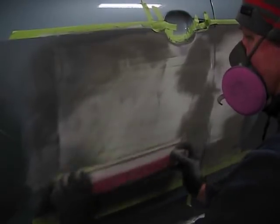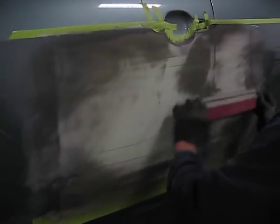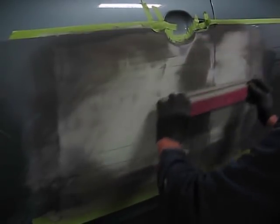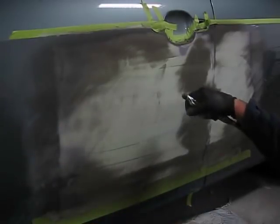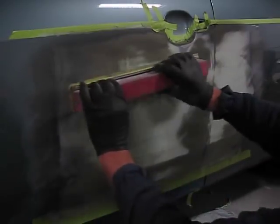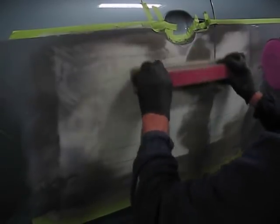We can see two areas right in the middle close to the door jamb, which I expected. That was the lowest part of the damage. That comes up almost immediately. The rest of it around it's looking pretty good. We're sanding. We can see the pencil lines on the panel. It transmits through the Bondo and gives you an indication even after you cover over it. Cleaning it up a little bit with blowing off the dust. Continuing my sanding. I'll continue sanding this until all the Bondo has been sanded and I'll be able to identify what needs to be done in the next sweep.